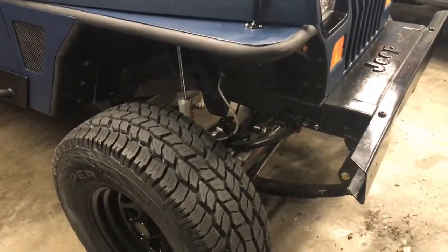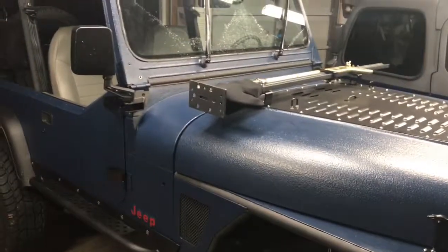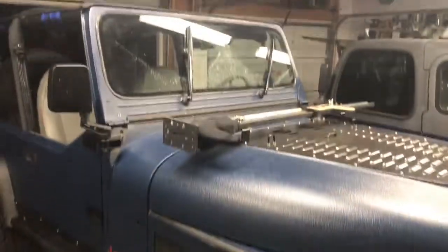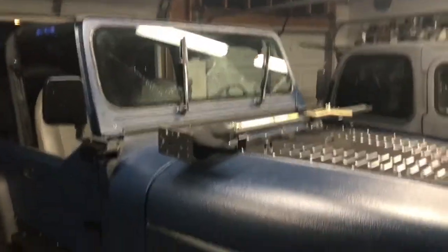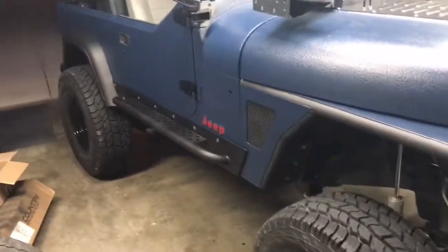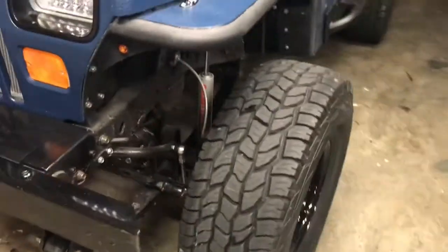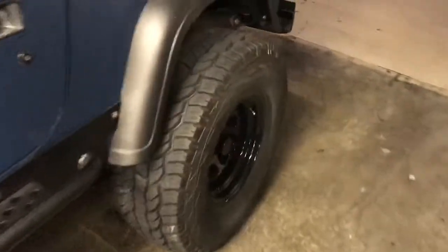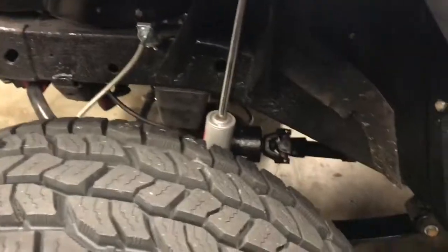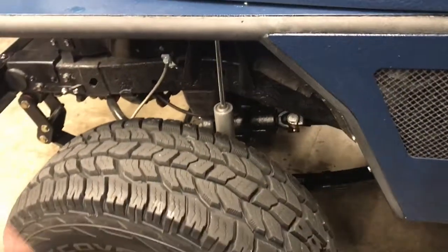I just took the Jeep out for another ride — Jasmine, my bulldog, went with me. She's freaked out because she actually got inside the thing she's been barking at this whole time because it's noisy. I got the windshield washer fluid working, the third brake light on, and the brakes bled. The back brakes had a ton of air in them — I forgot to bleed the back brakes. Also developed a power steering pump leak; looks like the high-pressure hose just backed off so I tightened that back up. Got to go back and get that inspection again.